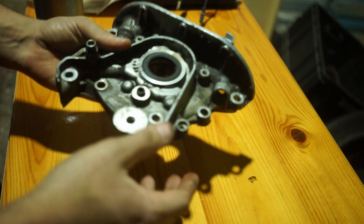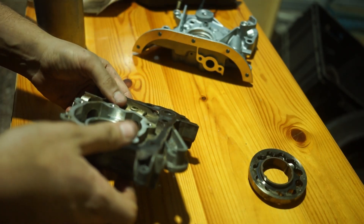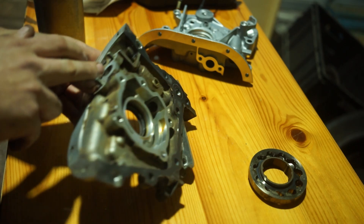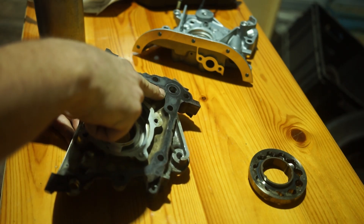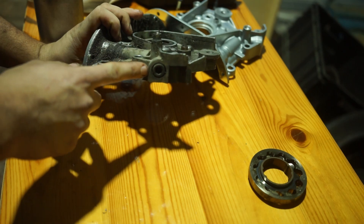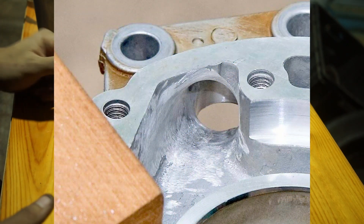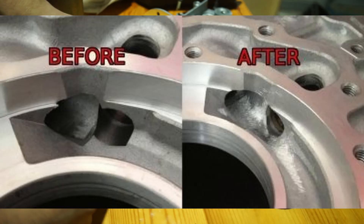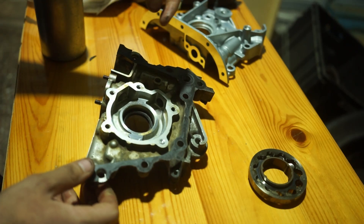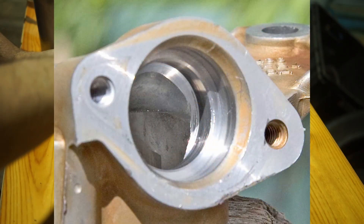The next thing you can do, and is actually recommended, is to port your oil pump. A lot of people have explained this before, so I'll give a quick overview. You can see this hole here, which is the oil passage. The pump sucks oil in and pumps it into this hole and into the block. You can remove this bolt and port the opening — make it a bit smoother with a curve inside — which leads to better flow. You eliminate the sharp edges on a normal drilled hole, and you can also port the 90-degree bend the oil has to go through, so it can travel smoother into the oil gallery.